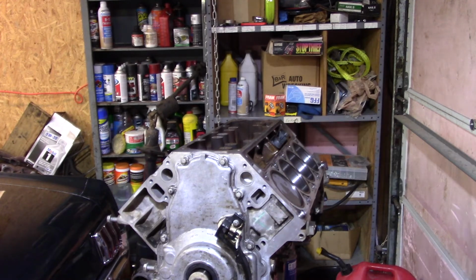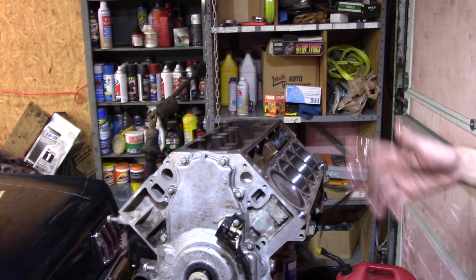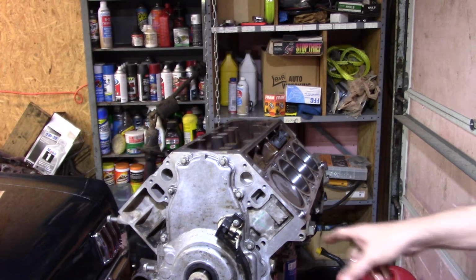I'm going to go ahead and do the rest off camera. Like I said, I think my other video has it on there doing it. Obviously your Gen 3s that do not have active fuel management, and some of the Gen 4s that don't. And there are a lot of Gen 4s that don't. It seems like a lot of the 6 liters, especially the early ones I've seen, like 2007, 8, 9, and the trucks, they have variable valve timing, but most of them do not have active fuel management.